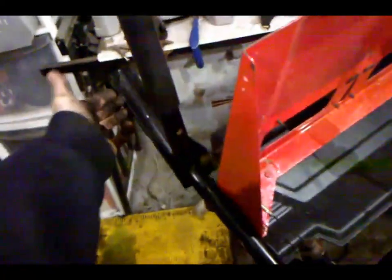Next we've got the little spring-loaded piece down here that's rotted out, so let me see if I can get this out of there. Here's that old one. Now if you look at the new one — it's broken the little hook off, which isn't a big deal, it's a common issue. This part here is only about $2.50. We're going to stick that on — that was pretty simple. This is mainly the little squeeze grip up here for the auger control, and it works very nicely — it all releases nicely, very tight. That's how they should all work.